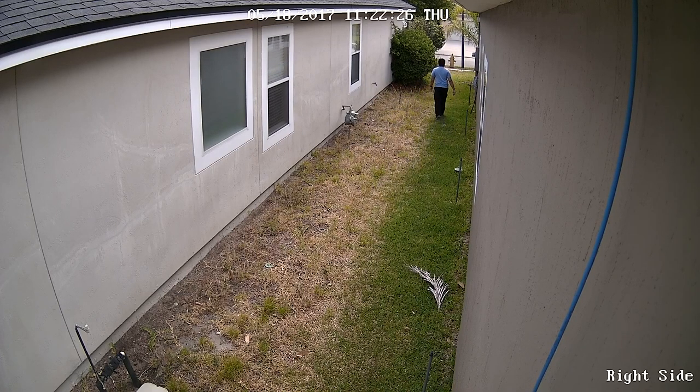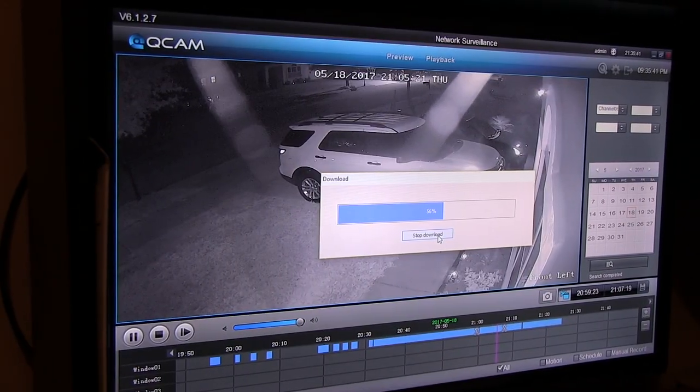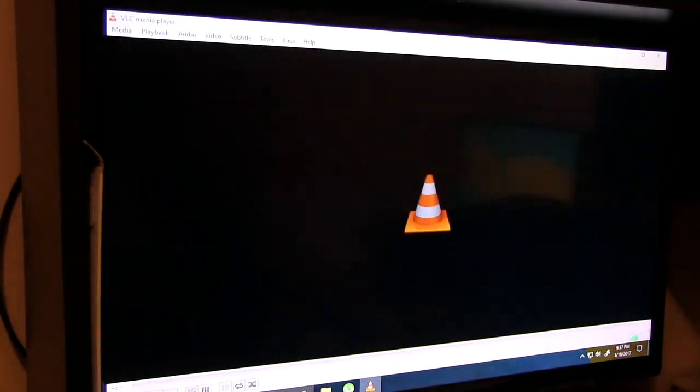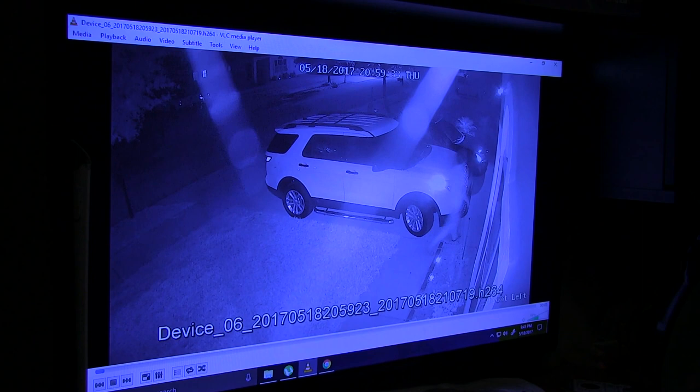The camera and NVR support ONVIF, so you can add ONVIF-supported IP cameras to this NVR and have it handle recordings. You get access to the QCAM mobile app and their PC and Mac software. The Mac and PC software lets you configure your NVR settings but it's flaky — sometimes the settings save, most times they don't, and you have to go in and make the setting change on the NVR itself. Downloading videos using the PC/Mac software isn't too bad, however if you have the software converting the video to AVI then downloading, you'll end up with a video only 3 seconds long — it has to be a glitch. If you don't convert and just download the H.264 video, make sure you have VLC installed and configured for H.264 and it should work.